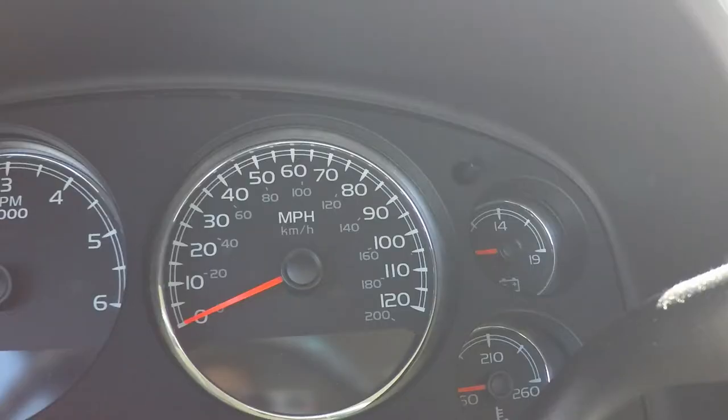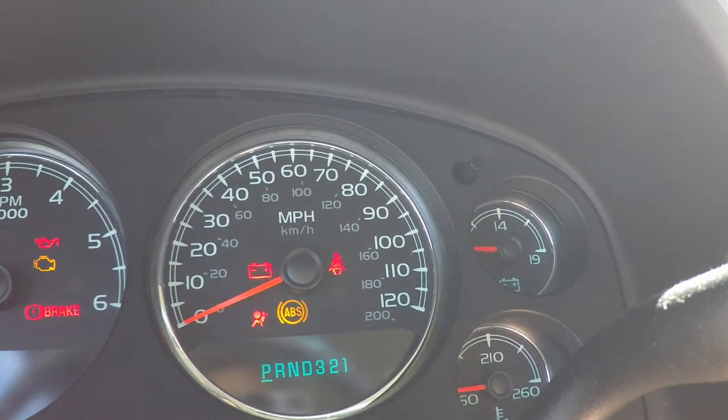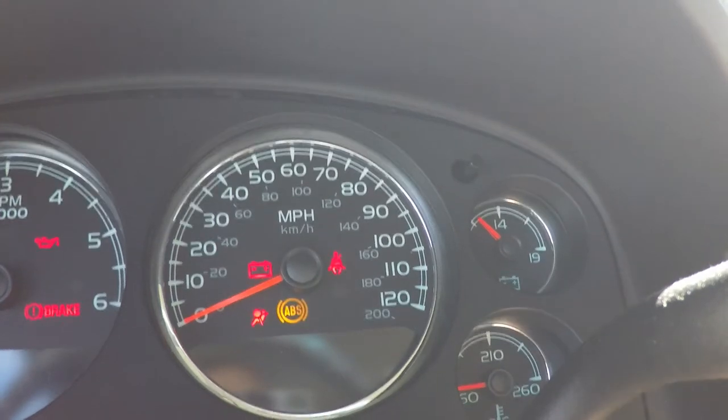All right, so we're going to start this vehicle, and I want you to pay attention to this gauge right here. I know you can't see where it is right now, but it's pointing at 9 volts. It's just basically off position. And then 14 volts is about in the middle, and that's where ultimately it's going to hover around as we get closer to our actual power fully on. So we're going to start it. Got our warning lights that come on. Tells us what our current state of charge is. A little bit more than 12. And we start our vehicle.